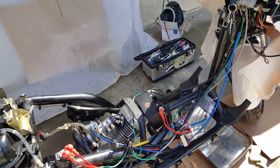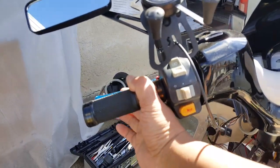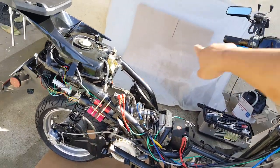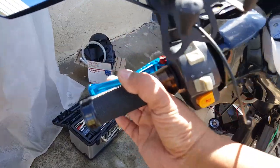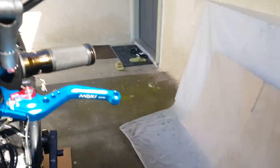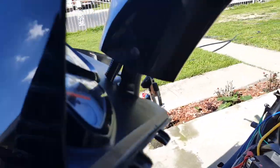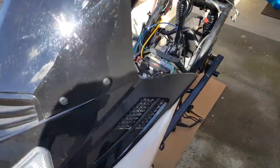Tilt your handlebar in more like this and then you can reach for the rear brake because it's within reach. You don't have to have extremely long arms — you can still make it work from this side. You can reach over, grab the brake lever, open your brake bleeder bolt and do your thing. This one has a really nice firm squeeze — that's what you're looking for. This one's actually even firmer, but I'm just hoping the JB weld we did doesn't leak. So far I'm not feeling any brake fluid substance.